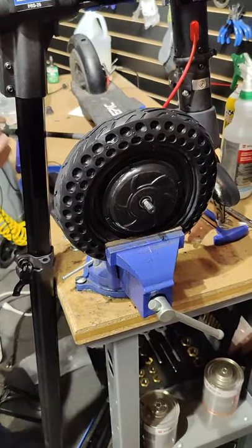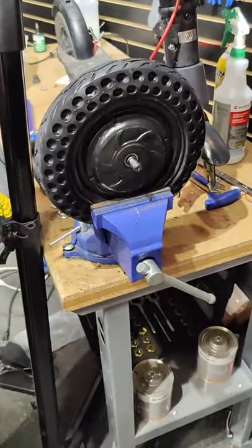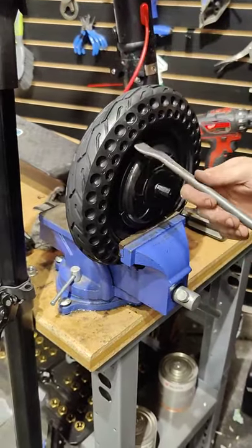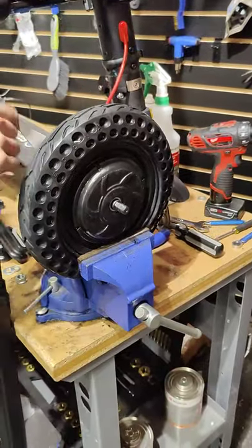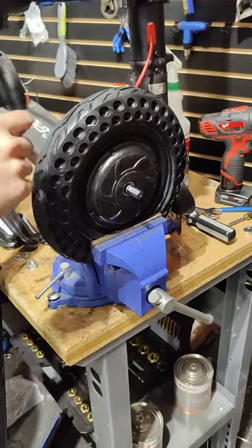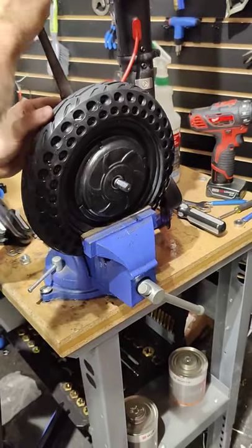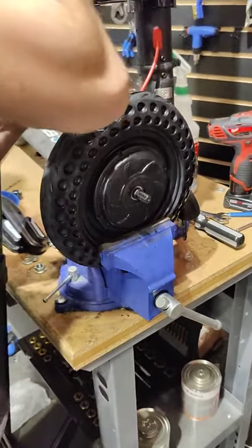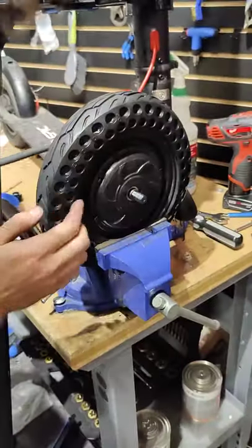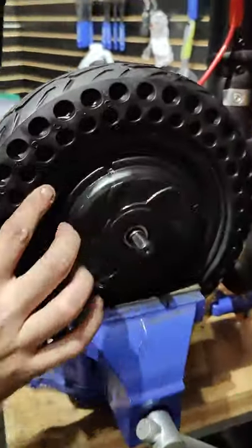Go around the whole tire — I'm a little limited by the bike stand here. I'll slip it out, and you can see it's already a little bit better. I'm going to have to do this a couple more times. It's usually better from the non-exposed side. I'm going to move the bike stand holding the scooter a little bit, then pull the rim back, kind of letting it flick off. Now you can see it's starting to enter — it's not perfect yet.